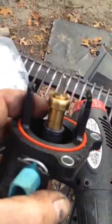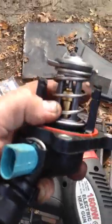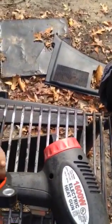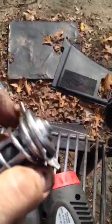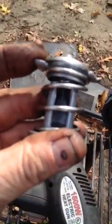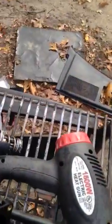This was the first one I put in. I called the company and told them I didn't think the thermostat was sealing all the way, and they sent me another one. The thermostat sits in here and locks in place — it seals on both ends. When I got the second one, I called them back because it did not close the other port. That's what I think happened to the first one too, but I didn't know the locking tabs had actually broken off until I removed it.